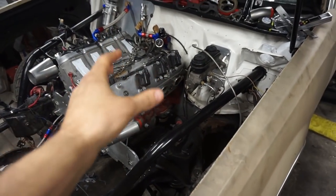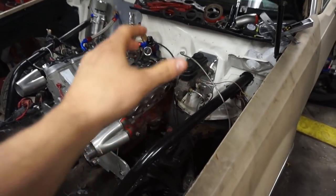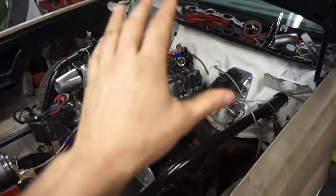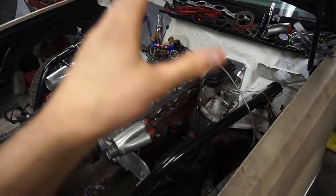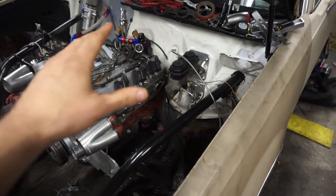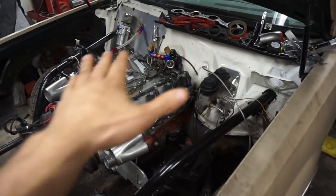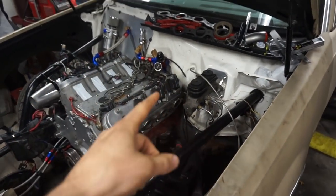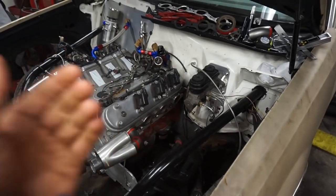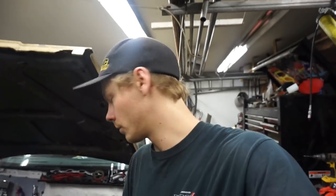This is new to me as well — I thought originally the mid plate held up the transmission, so that when you pulled the engine out the tranny stayed in the original spot. But it's actually the other way around: the mid plate holds the back of the engine. So when you pull the transmission, the engine still stays in its original spot. And when you put the transmission back up, you have your two dowels on your engine and that's what lines it back up. If you didn't know, now you know.